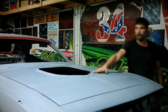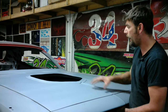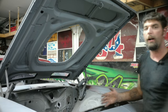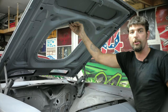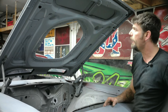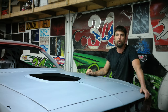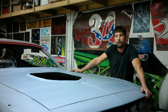So we got our shaker ring — there's going to be some bodywork that's got to be done. This hood just fits so much better than the Golden Star, so I'm still happy with the route we went. If you look underneath this hood, all this is finished out pretty good. I cut the bolts down for the shaker trim ring and it does fit really nice up in there. Even if you get an aftermarket hood, you're going to have to re-weld all these bolt holes and grind the shaker hood to make it fit even better. No matter what, I don't think you're going to get out of just bolting something on and calling it a day. But you see, it's all primed, the rough bodywork's done, and we're going to take it to the next step. The hood opens and closes really good. Next step — we're going to touch up some more things, get it on a rotisserie soon, and start the bodywork phase. Most of the metal work is done. All the panels are gapped pretty good, so stay tuned for that.